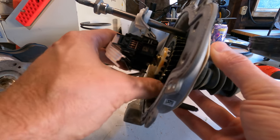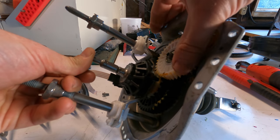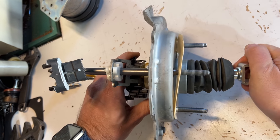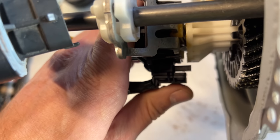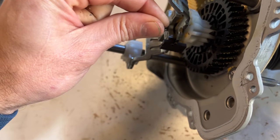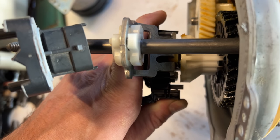Here's what's going on. Let's say you don't have any electricity going to this thing — it's not doing any boosting. When you press the brake pedal, it pushes on this input here, which slides this whole thing forward. This little metal part pushes on your brake master cylinder, which pushes brake fluid into your calipers and makes you stop. These metal bars here are just to keep everything in line. Pushing that brake fluid and squeezing the calipers takes some force, so as you push on the brake pedal, you get some resistance inside here. There's a spring, and as that spring squishes, there is a little bit of movement between the pedal input and the output going to the brakes. Inside this little black plastic thing, there is a sensor, and attached to the input side is a magnet — confirmed by throwing some metal shavings at it. So you push on the brakes and the harder you push, the more the spring squishes, and the system knows exactly how hard you are pressing on the brakes.